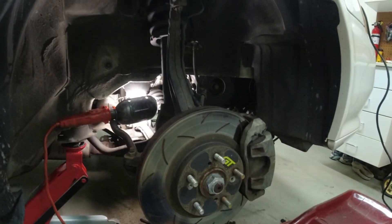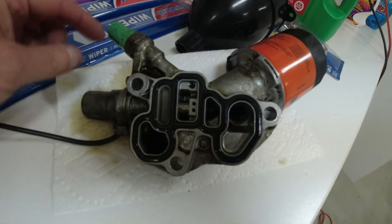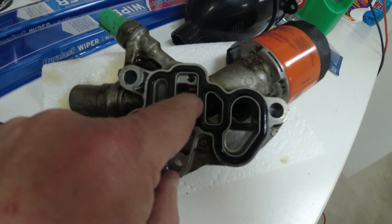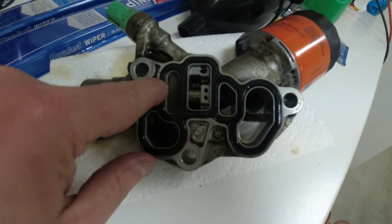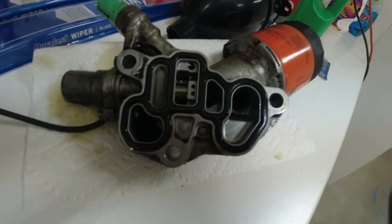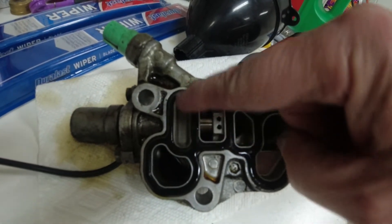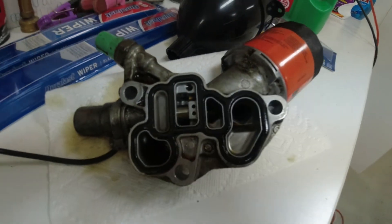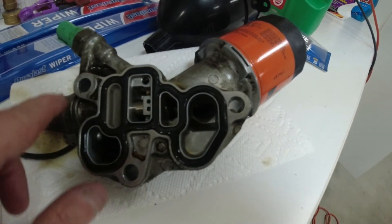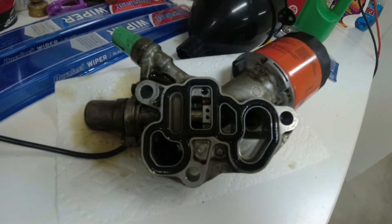So here's what the VTEC unit looks like. There are two sensors here, and then there's a plunger here that redirects oil, and this screen — make sure it's clean. I've cleaned this before, so mine's okay. But if your VTEC ever malfunctions, it could be that the screen is clogged with oil sludge. It just has this rubber gasket — that's the only thing, there's no sealant or anything. It's just three bolts, and that rubber holds it on and keeps it from leaking.